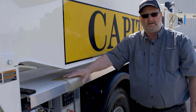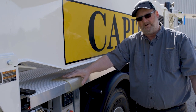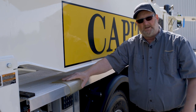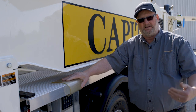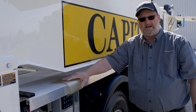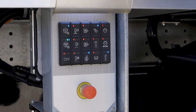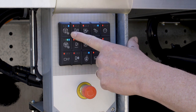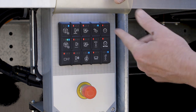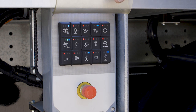The rear step switch box is now a CAN bus component, which means one small CAN bus wire supplied with four wires: power, ground, CAN high, and CAN low. So the harness back to the switch box is a lot smaller and more efficient — it is a one-piece replaceable component, just plug and play, instead of a whole bunch of independent switches we had in the past. All of the buttons have LEDs that tell us status: a red LED indicates the switch cannot be activated; a green and blue LED indicates the switch is good to activate.